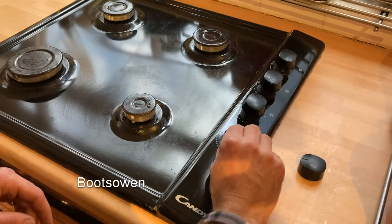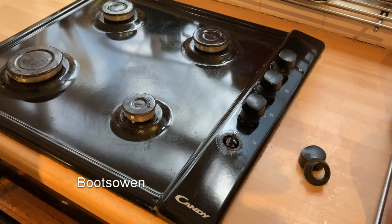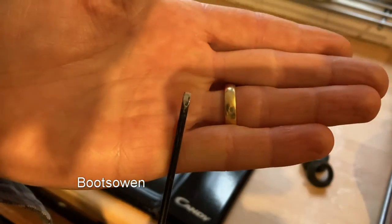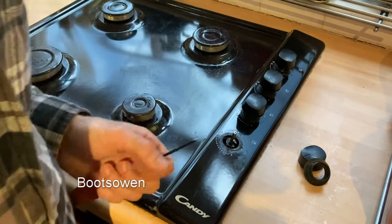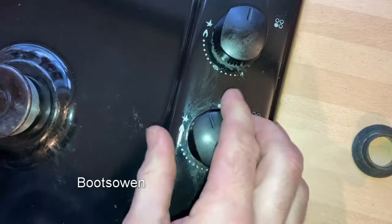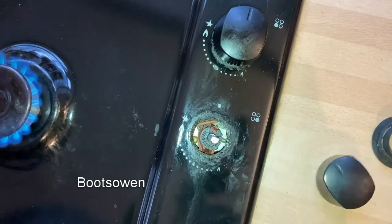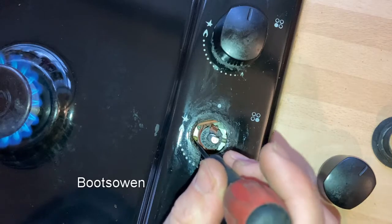Pull the knob off. Pull out this rubber thing, just like that — it's a bit grimy in there. And then with a small flat-bladed screwdriver, somewhere in here there should be an adjusting screw. I think I can see it. So what I might do, for funsies, is turn it on first so you can see the flame. I'm not going to have my face cooked. Put the screwdriver in here — you can see the little brass screw down there.